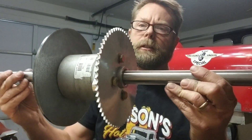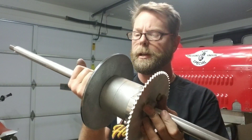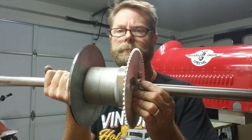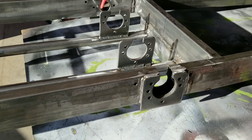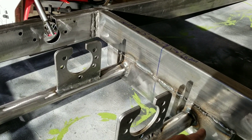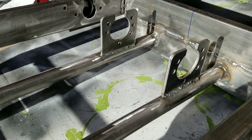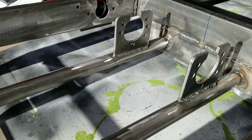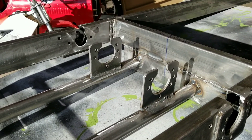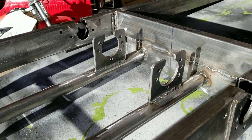I got the sprocket and the disc brake installed — that's what the assembly looks like. Once I get it on the cart with the chain on, we'll torque those down. Before putting the axle in the cart, I had to mock it up with the brackets and install some rods underneath. I added an extension below the frame rail to give it some depth for the inner bearing mounts. I used some really stout round tubes this time. The purpose of these inner bearings is that because there are basically two axles attached at the center, without those inner ones you can get flex and it'll cause the Peerless axle to fail.